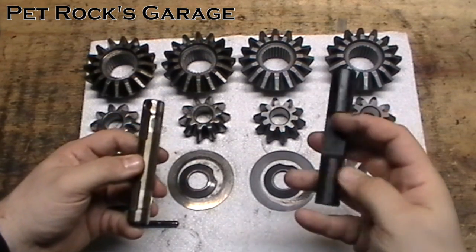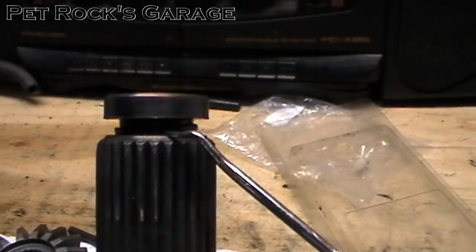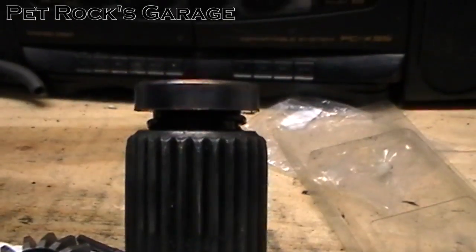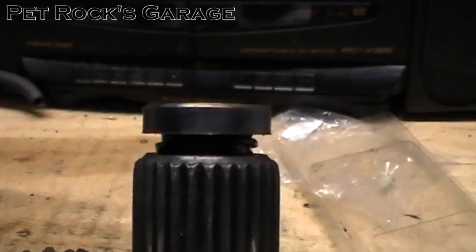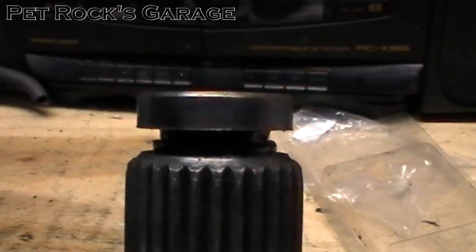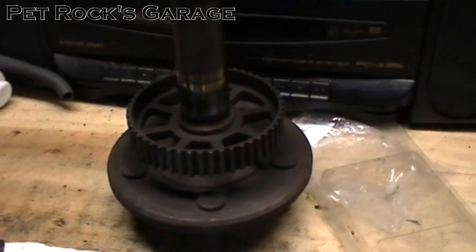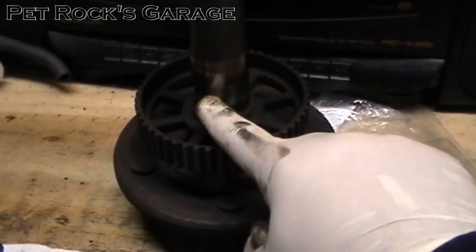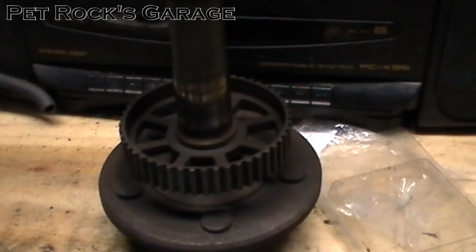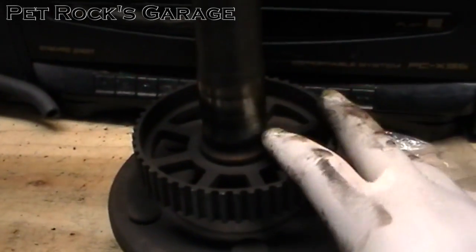You want to make sure that the O-ring in this slot right here — if you wiggle it up and down and it's damaged or missing, you need to replace it. I'm not entirely sure what it's there for, probably a shock absorber dampener for the C-clip that holds the axle in place, but it's there for a reason so if you don't have it just install a new one. You also want to clean off and inspect the areas where the seal and bearing ride — make sure there's no cracks, pitting, or gouge marks. Also check the condition of the ABS tone ring, make sure it's on properly and secure because it's only a press fit.